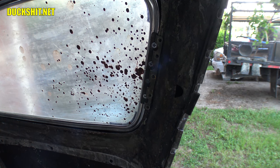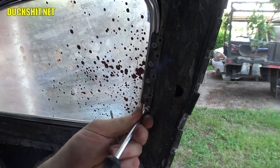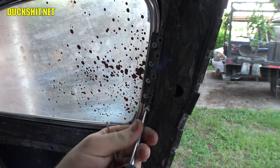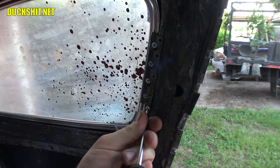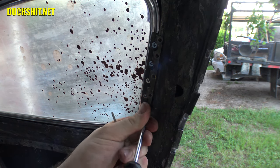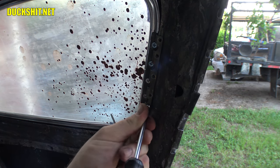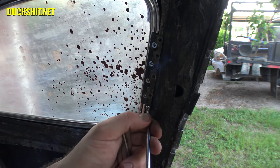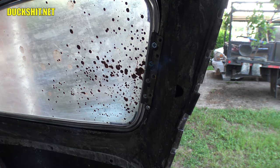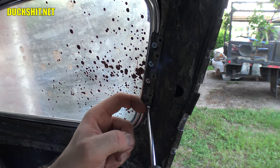Make sure that you have a screw, and make sure that it goes into the holes that you've just made. It's actually a little more snug than I wanted it to be. It's actually threading into my hole. Wonder if it'll tighten down. No, it won't. It's probably just that the hinge, yeah, that's exactly what it is. The hinge sprung back because these are just spring steel.